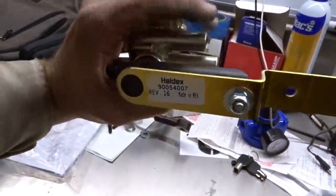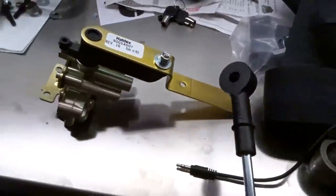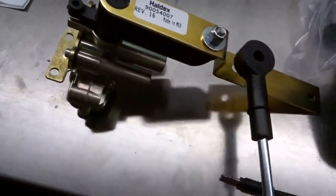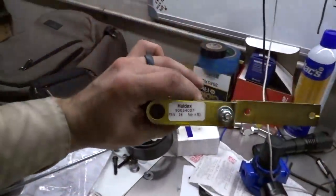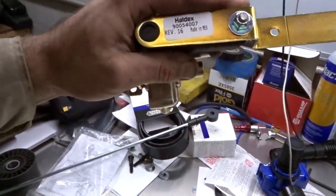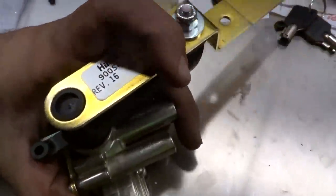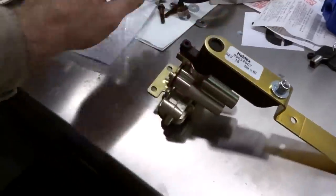With this truck I'm going to be running a leveling valve. So leveling valve plus this rod here - if you don't know what that is, big rigs essentially all have leveling valves where at a certain height air doesn't escape one way or the other. Then as the suspension changes up or down, air is either supplied or decreased. So that's what else we're running on that.